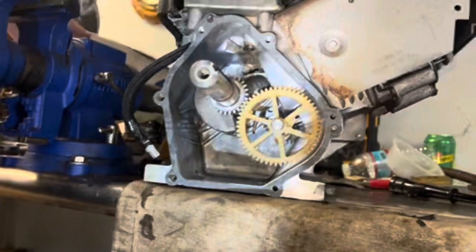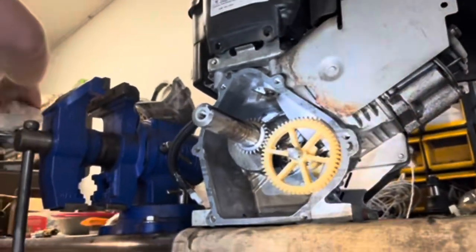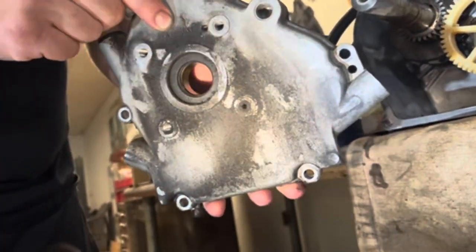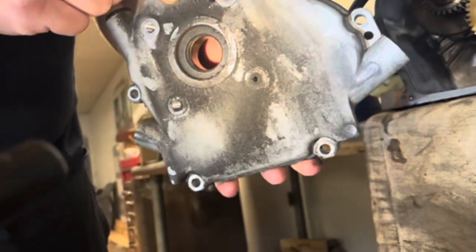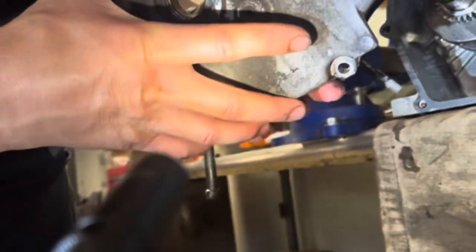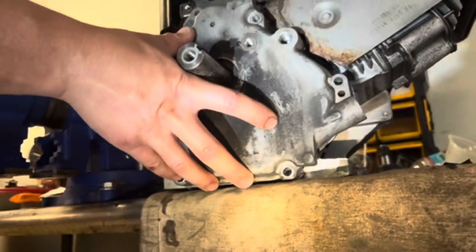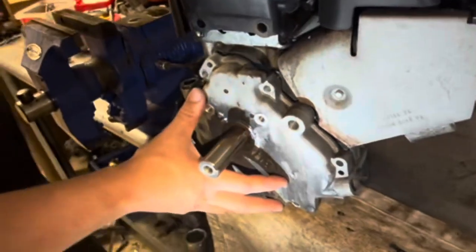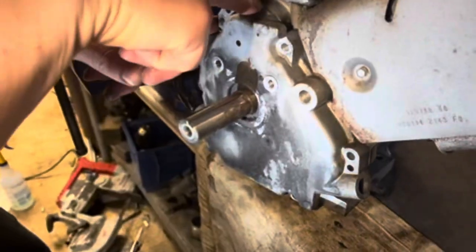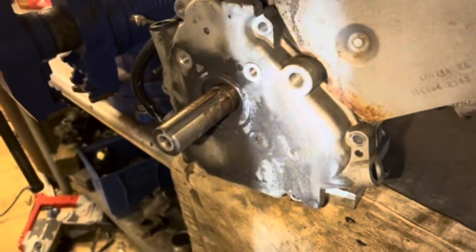You can use some sort of gasket seal if you really feel like it, but you don't have to. The gasket's pretty good at sealing these front covers. If you do have a bad seal, now is an excellent time to replace it. Ours looks like it might be weeping a little bit, but it's not the worst I've seen — it's mostly just belt material that's a little oily. So we might go ahead and replace the seal if we have one in stock. If not, whatever — it's a snowblower, not a Ferrari. I'm going to reach back here and pull this over just a little bit to get that lined up, make sure it's sitting flat on all these spots. Then we're just going to go ahead and zip all the bolts back down and mount it back to the machine. We'll see how it is to turn over.